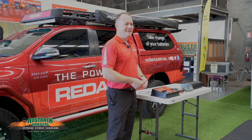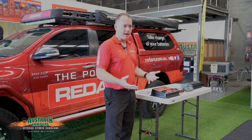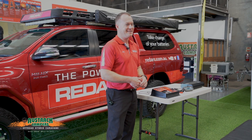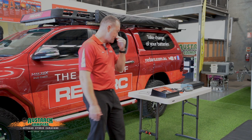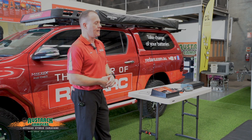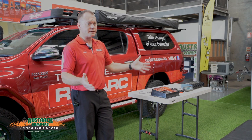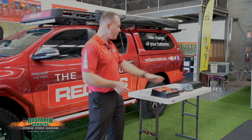Lithium batteries look like a normal battery but instead of being 35 kilos, they're about 12 kilos — the first time you go to pick one up expecting the weight of an AGM, you nearly put it through the roof. This product has been in the market for nine years, so it's got real stability and is well-known. All our products are universal — not vehicle specific — so this is at home in your caravan, camper, or vehicle. When adding additional solar, such as a folding kit, make sure it doesn't have its own regulator on the back of the panel, because you need to bypass any other regulators — this unit already has a solar regulator built in and needs unregulated input. This unit also has MPPT — maximum power point tracking — which loads the panel to hold it at its maximum power point.